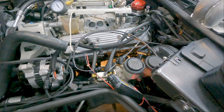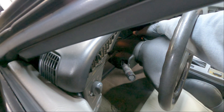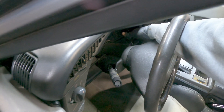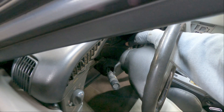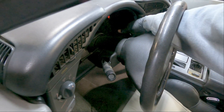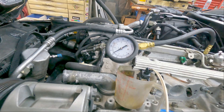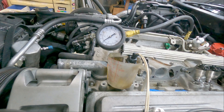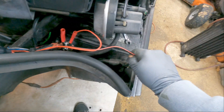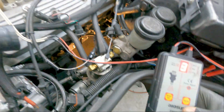I ran that fuel pressure way low so I may have to do this several times. Turn the ignition off, wait about 10 seconds. I should have waited longer — it didn't do anything that time. There we go — fully charged, it actually went up to about 43. To change the mode, go to the battery, disconnect it, come back over here, set the mode — I'll set it to three.